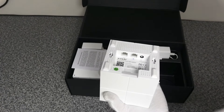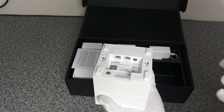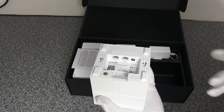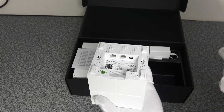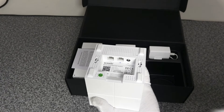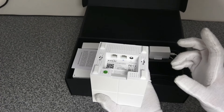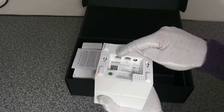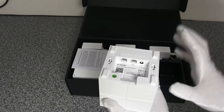You can also use the Nova nodes as connection points for wired devices. For instance, if you had one in your lounge and you wanted to plug in your Sky TV box as a cabled device rather than hooking it up via Wi-Fi — which is beneficial because Sky boxes can be a bit flaky in terms of getting an IP address over Wi-Fi.